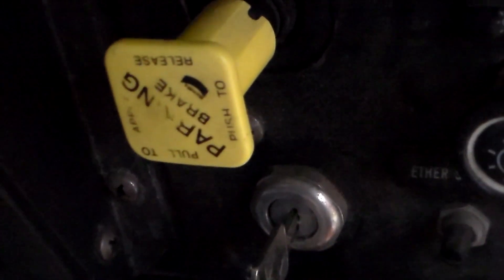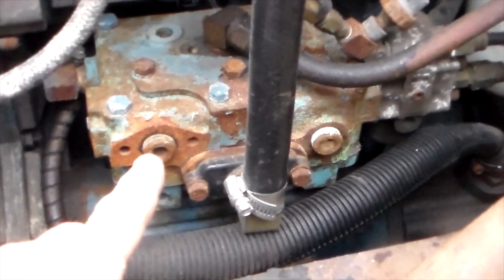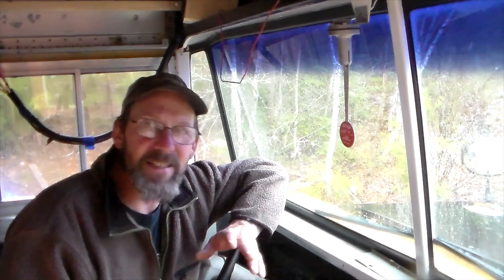The components of your air brake system are actually pretty close in many ways to a conventional hydraulic system. You have your service brake pedal and your parking brake lever. From there, air goes to the compressor in the engine compartment, through the governor which regulates pressure, and into the tank. Many newer tanks have three sections: the wet tank where condensation collects, the primary tank which holds enough air for about eight to ten brakings, and a secondary backup emergency tank.